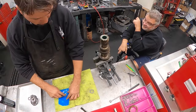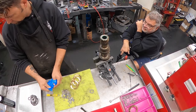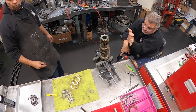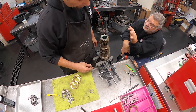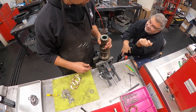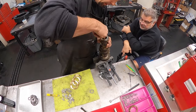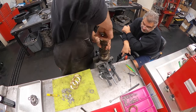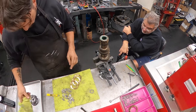What you do is you start the rollers and put them about an eighth of an inch, quarter of an inch down in the hole and stack them. You've got to put a washer and then slide it with the pipe. Then put a second set of bearings, flip it around, put the tube in the middle, then do the same thing on the other side. There are four rows of bearings. You can grease it down there good, but you've got to build it at the top and then slide it down as you build it.